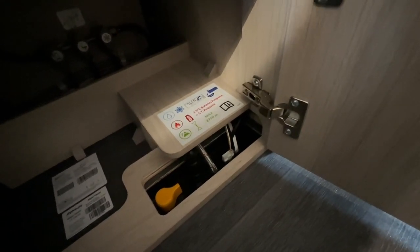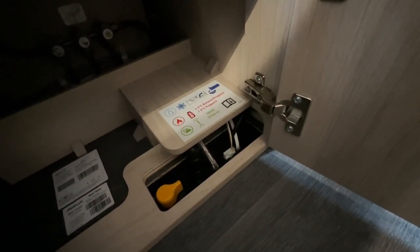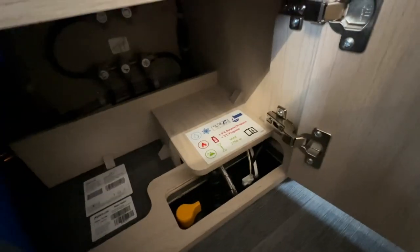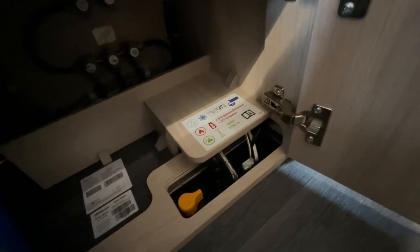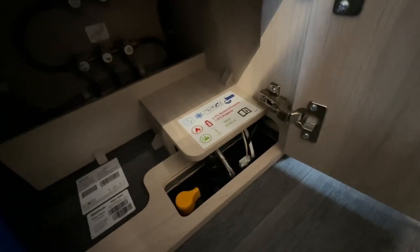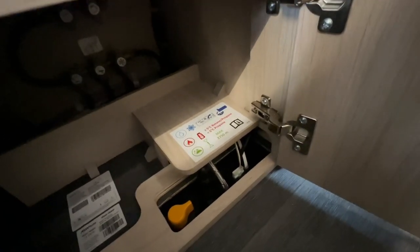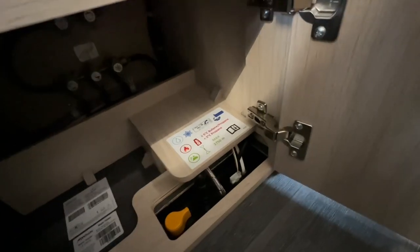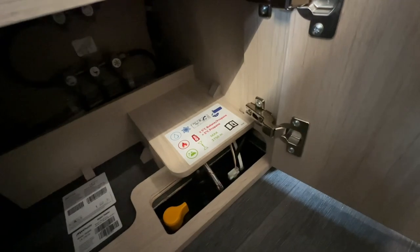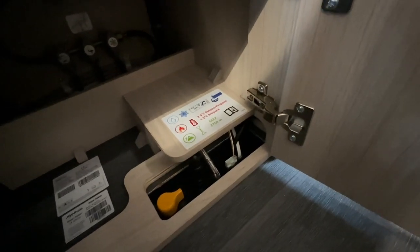When you come to reuse it, point the toggle back towards the cab. Shut the taps, shut the fresh and waste valves, fill the vehicle with cold water from the fresh water inlet outside. Turn the pump on, open the cold side tap slowly, then go around to the hot - you'll get a lot of compressed air out until you get a free flow of water from the hot side, which tells you your boiler has reached maximum capacity of 10 litres.